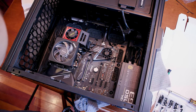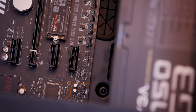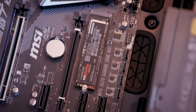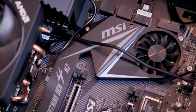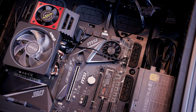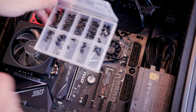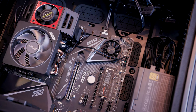Okay, so here's the motherboard, and I'm just going to zoom in here slightly. Well, actually a lot, whoa, extreme close up. But you can see that over here in the corner, barely, there it is. There's one hole starting there at the very edge, and then there's the second one, the third one, and then there's another one up there, and they come straight across to the center, and so forth. So that's where we're going to insert our screws. And I'm just going to lock this off for a second. Let me see here, I need my screwdriver. And we're going to be using those wonderful screws that we had before. We're going to be using the center ones, the smaller ones right there. And we're going to go ahead and get these put into place. There will be 9 total.